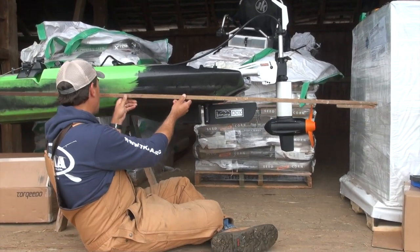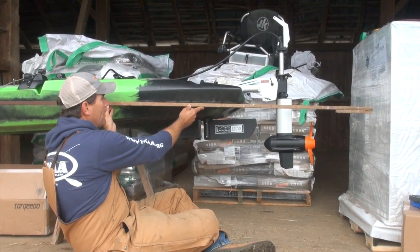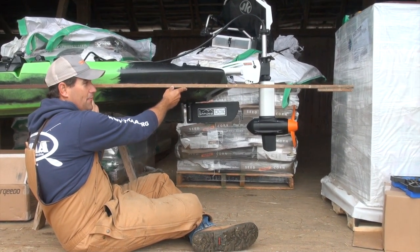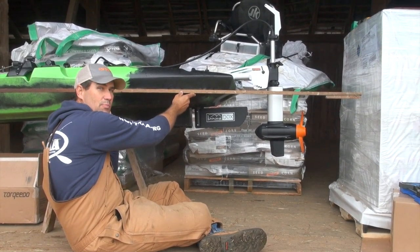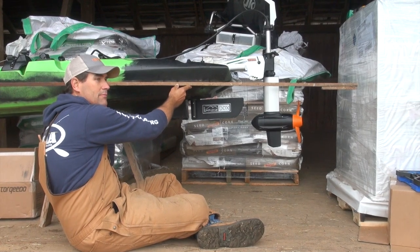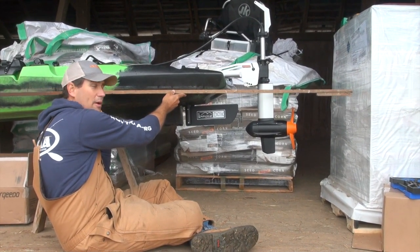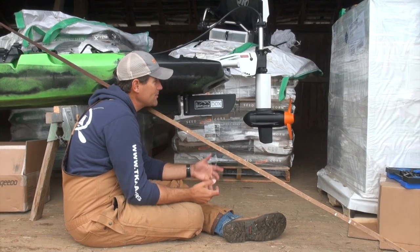What we're doing here is I got a stick that I'm lining up, and I'm really matching that water line. I'll come right up to it, and you can see that propeller is well underneath the surface. If that was the top of a 403 propeller, that's about right. You got about 4 inches. But this propeller, and even the weedless version, is really good at coming very close to the surface without slurping. That being said, I think we could eat up about 2, maybe 2.5 inches of the length, but this profile, being as tall as it is, keeps us from going any higher.